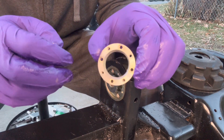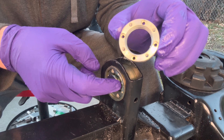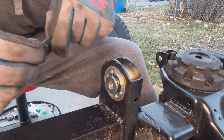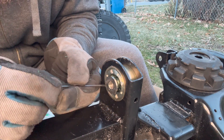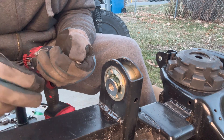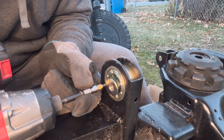Take your outer retainer for the other side — remember every other one of these holes is threaded, so you want to line up the threaded end with these two bolts on the other side. Now take the provided Allen and thread some of these in just to start getting them to catch each other. You can do all of this by hand until you have to torque them at the end, but to speed up the process I'm going to use my impact driver just to snug them down.